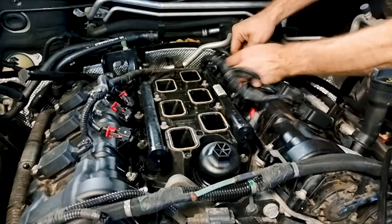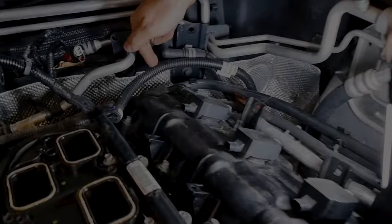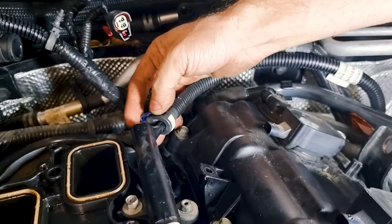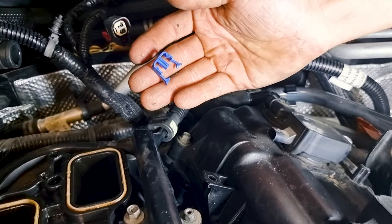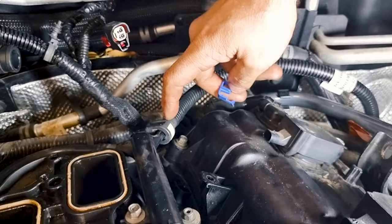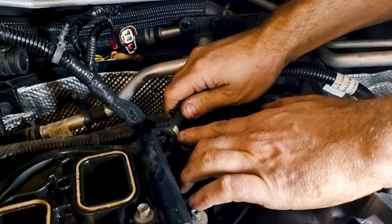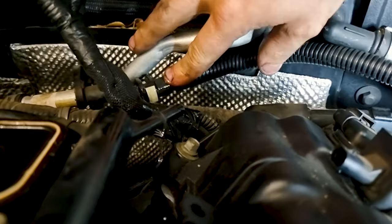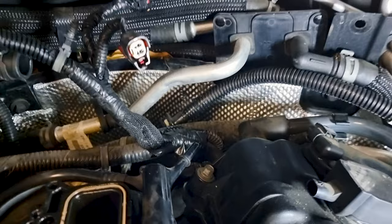It is easier if you just undo the coils on the side — that way you can swing the loom all the way out of the way. This is your fuel supply to the fuel rail. There's two stages to releasing it: the first is this blue locking collar — they're very brittle and they do break often, so try not to break it. Make sure when you're going back together that you put it back on, otherwise this hose is under pressure and it can blow off, spraying fuel everywhere. Push it in a little bit and push that white bit in. It'll drip a little bit of fuel — don't turn the ignition on or you'll empty your fuel tank all over your firewall.